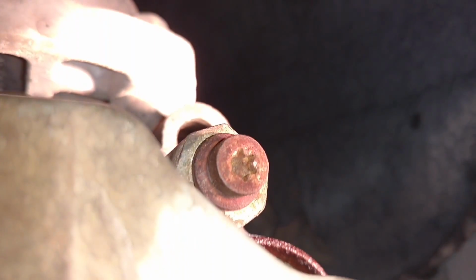And yeah, if the gasket's really bad, you're gonna need to replace it, guys. So, underneath the draining pan with not very much space. By the way, those are Torx 30 bolts, or actually more like fasteners, because they don't screw into the actual pan.